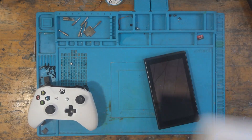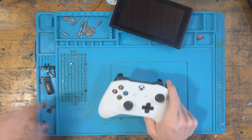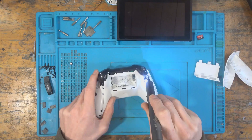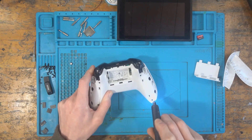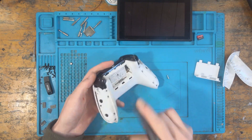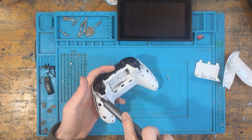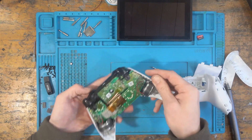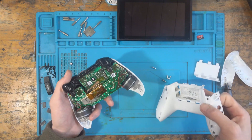Let's start with the simplest item first — the Xbox One S controller. According to the listing it doesn't work on batteries. I'm going to take out the screws and try to pair it, and I can already see an issue: there's a battery terminal missing — it's probably been crushed behind the case. There we go — the terminal here is bent back, which is fairly common.